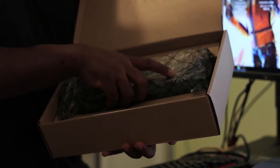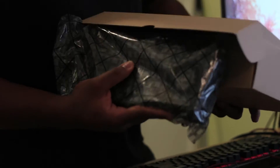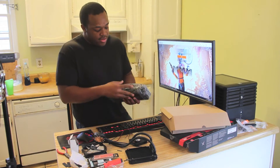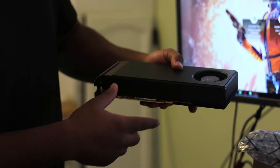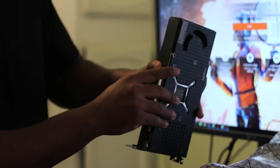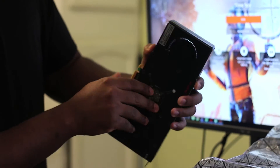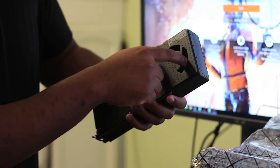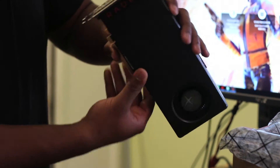This one comes with the core clock of 1328 MHz over the regular clock of 1266 MHz. It's also the one that comes with the shiny and pretty backplate. This is the reference card, reference PCB. You have the backplate that actually extends along further than the PCB, and that actually allows the intake fan to pull air while it's inside the case and scoot it out the back.